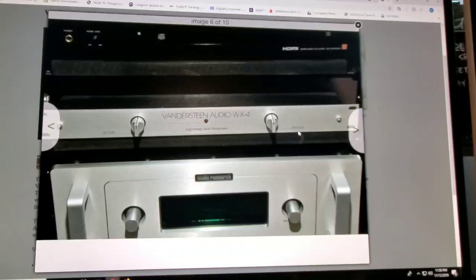So, and here we go. Yeah, right level and left level. So here's the level control. The level controls for the subs are right here, and then the level controls for the mids and the tweets and the highs are on the back of the speaker. This means you can set the levels for your room. No matter what your room is, if it has reflective surfaces or not, you have complete adjustability in terms of the gain for each different spectrum of the speakers, the mid, the sub, or the highs.